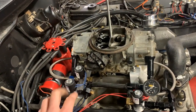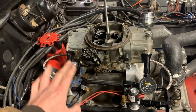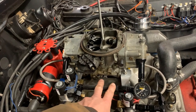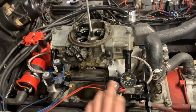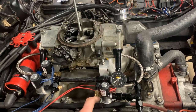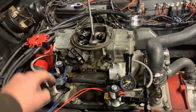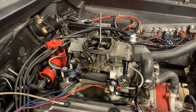Once I make this last change to this plate, I'm going to put blue Loctite on all these fittings and on the fasteners that hold the solenoids. I'll put the jets back in, put new gaskets on the plate between the intake manifold and the carburetor, and get all this sealed up for the final time. That way I can concentrate on just the wiring next. I still need to do the micro switch on the other side, and the wiring will come around and join this wiring as well.